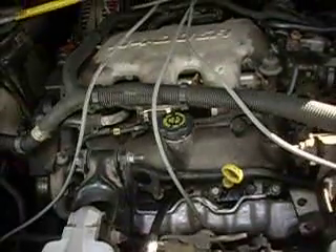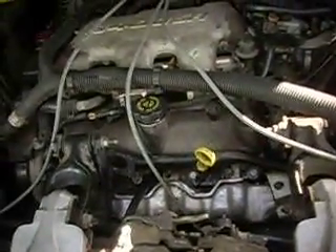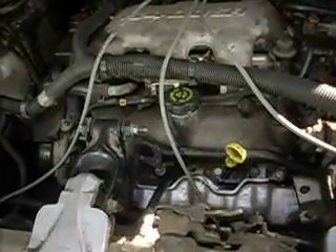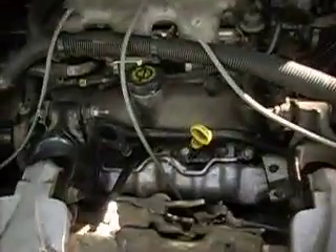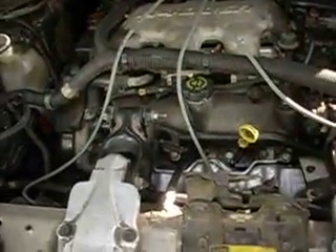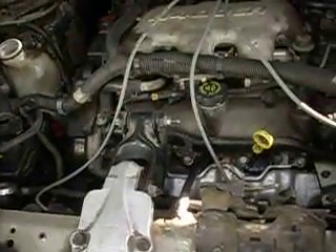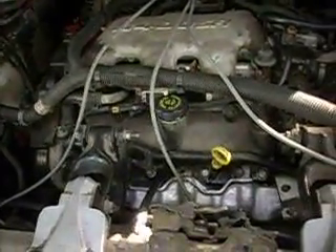I decided to find out where the compression was going on the center cylinder, so I broke out my cylinder leakage tester, which I've used on a previous video on a Ford Escort ZX2. To use that tester, you need to get the piston of the cylinder you're checking to top dead center on the compression stroke. You've either got to feel some compression out of the hose or pull the valve cover off to watch the valve train. I didn't have time to pull the valve cover, and I couldn't feel any compression through the tube while cranking by hand. At TDC, there are only two positions — compression stroke or exhaust stroke — and I tried it one way but couldn't figure out where the compression loss was going.